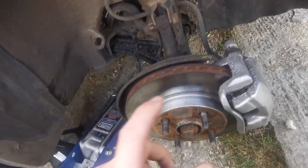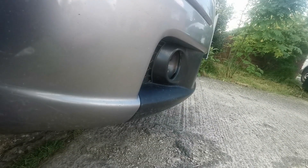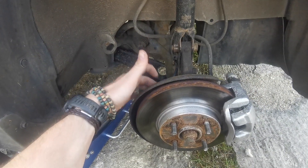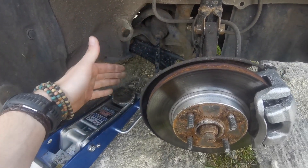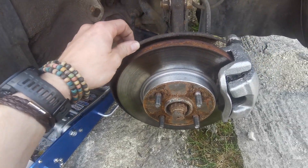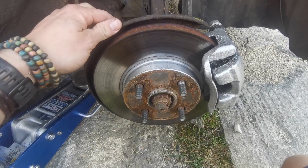The car's in the air. I'm only taking this off and routing some ducting from the front of the car — where the fog lights used to be — through to here, sneaking it underneath the drive shaft and bringing it up here. To get this off, I need to weld a bit to it. It's a bit manky — I was going to make my own, but this is actually a pretty complex shape to make up. It's got some inset and all sorts to it, so I'm just going to try and weld to this. It's mighty thin, but we'll give it a crack. To get it off I need to take the disc off, because the bolts that retain it are behind the disc — so caliper off, disc off, whip this off, and we'll have a look on the bench.